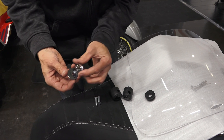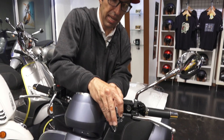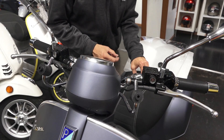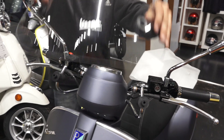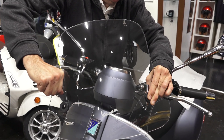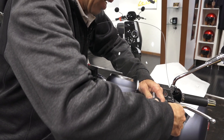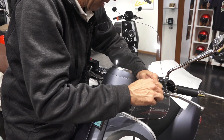If you over-tighten the screw, since these are plastic chrome caps, it is pretty easy to crack them. Start by dropping the nylon spacers with the metal pieces inside onto the two rods on the GTV. You'll need to support the windscreen and start with one side — push the grommet over the plastic peg. It may help to have two people, or just work with it and get the screw started.